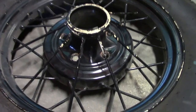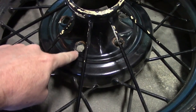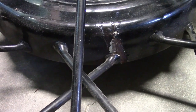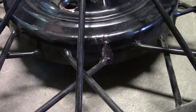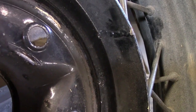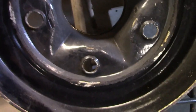First, we're going to look for cracks. The most common place these crack is at the edge of the hub, right around here. Another common place is around the lug holes. Around here, this is looking pretty good, but right over here we can see a good-sized crack right there — in fact, it's right through the weld for the spoke. I removed the paint on this area to make it easier to see, and that's pretty bad, so I would definitely not use this wheel. Looking on the inside, we can see that crack has been welded. It seems to be holding, but it's also cracked down here and cracked again up here. So I've already found three cracks in this hub.